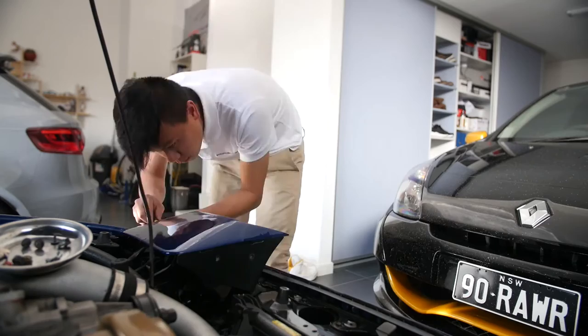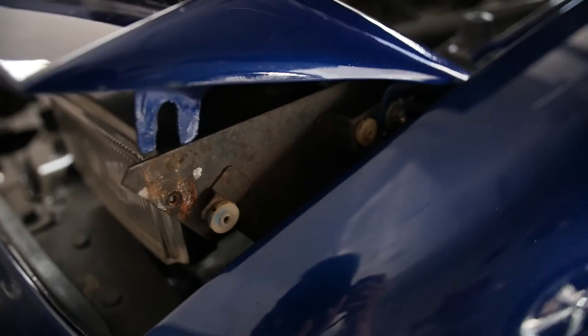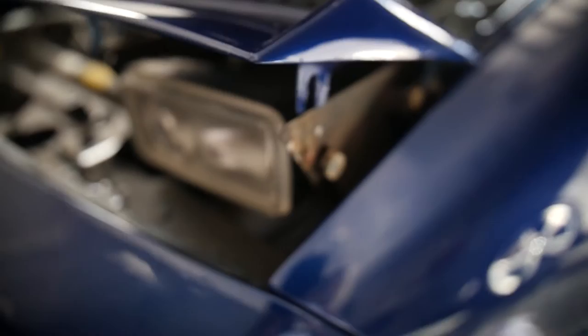So those screws actually take the cowl or the cover of the headlight off. And the one that actually covers the top of the headlight, there's four more screws inside. And then you take that off to get a clear reach into the headlight itself. Taking the cowl off and taking these screws out for the top cover, the problem again with a low profile headlight, I can't get to that one again. So I just put that up like so.